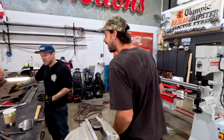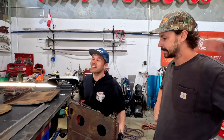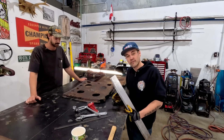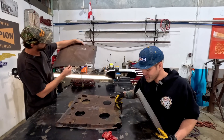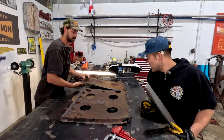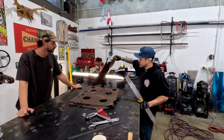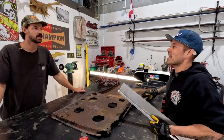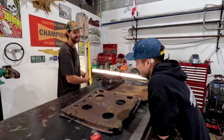And what are we doing, Carl? I picked the rustiest chunk of your car and started messing with it. So we've got the inside of the passenger door — wait, it's the driver's door. Oh no, it is the passenger's door — yeah, I got confused too. Just trying to make a panel to fix a bunch of the rust on the bottom of the inner. Separated it yesterday and we're going to use some profile dies and try to knock this bead into that inner skin. Once this is repaired, I'd like to have enough time to make a skin for this — just the lower skin. Keep as much of the original patina as possible, beat out all the dents and save as much of the original Henry as we can.